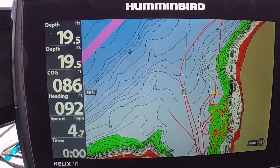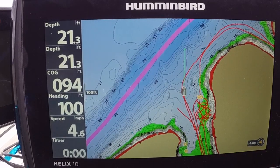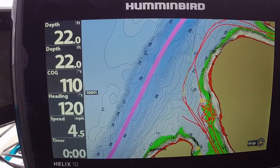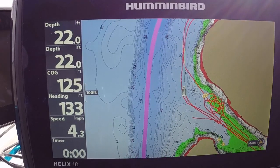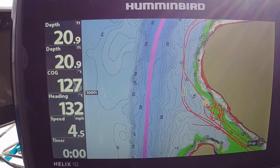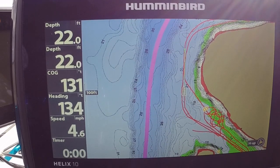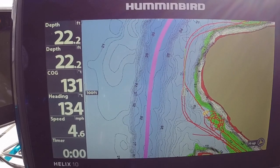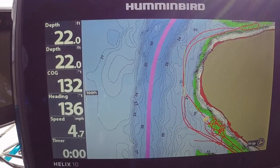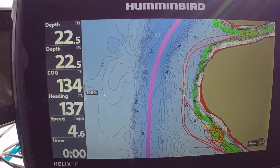You can see we're going around the corner, and as we turn, the purple line is telling us — let me zoom out a little bit — the direction we're headed. If you're having to do this in the wind, just go dead into the wind. Even doing it into the wind, you can tell if you have a lot of magnetic interference — you're going to have eight, ten, or fifteen degrees off.